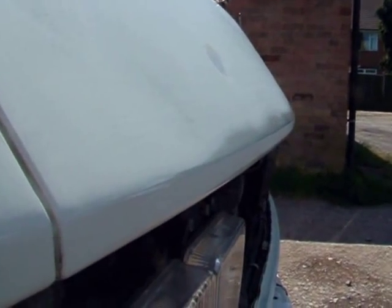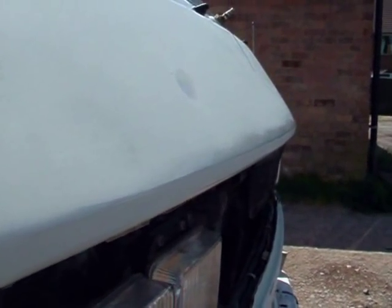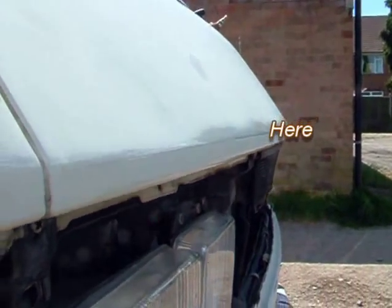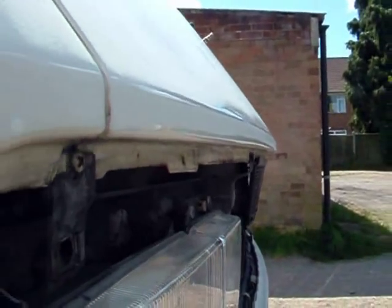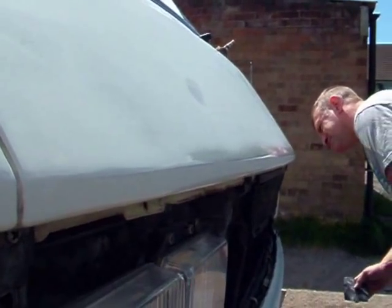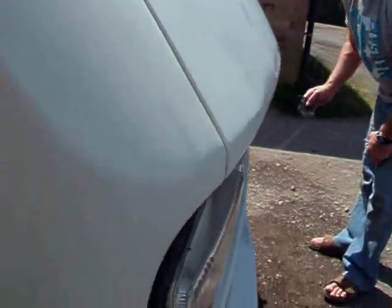The central thing is to get all of these areas matte. If you look at the bonnet where the light catches and reflects it, those are areas that need to be sanded down. If you don't provide a good key for the paint it won't adhere and it'll be peeling off before you know it. These other areas on the front quarter panel have a slight dent — you can almost see it in the reflection. So literally we take some filler, fill it, sand it down smooth and blend it with the rest.